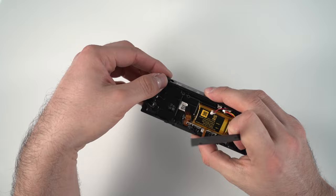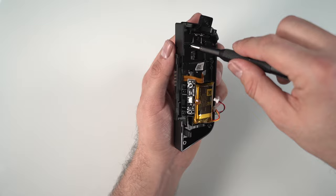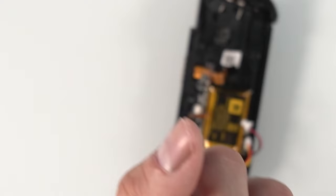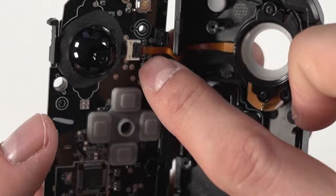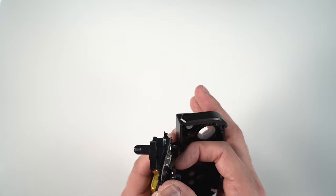Once it's loose we can leave it and move on. Next we're going to remove three PH1 screws holding the plastic board cover down. The first two are straightforward but on the bottom one be careful — there is a tactile switch right beside it. Now we can lift the board; there is one cable still attached underneath so don't pull it out too hard and watch for any cables that may have gotten stuck. The remaining cable has a little flap to lift up — it has two little wings and you place it in the slot then close the flap. Now we can put the front of the controller aside and focus on getting the joystick off.